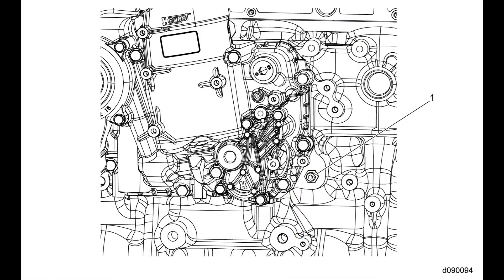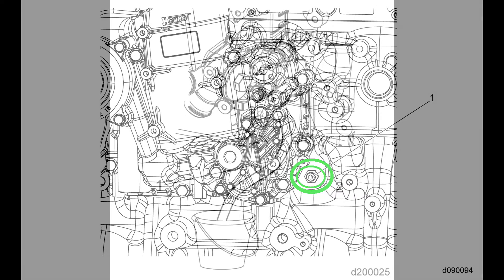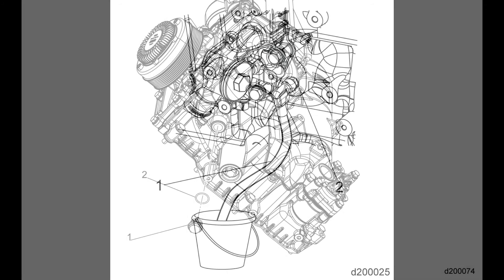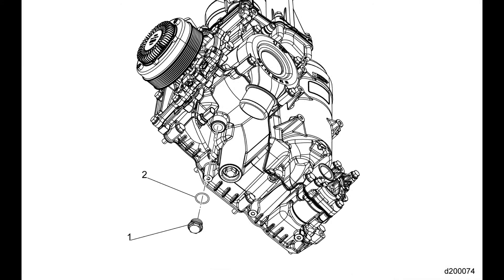Here you see on the left side of the engine, just behind the oil coolant module, there is a drain plug. If possible, it's a good idea to attach a hose or fitting to this plug because a lot of coolant drains out of the block. It's best to direct it into a container because if you just let it fall out on the side of the engine, it will run down over the ECM. The oil coolant module will also hold a lot of coolant inside of it — all the coolant held inside the thermostat housing and water pump area are all going to be contained in there, so it's best to drain it out also.